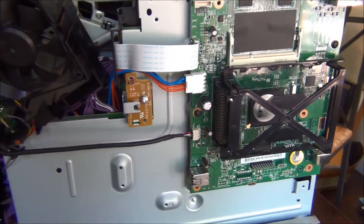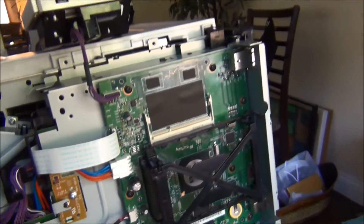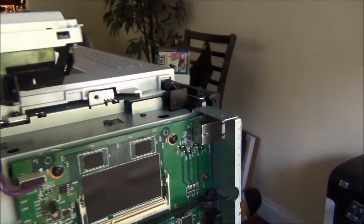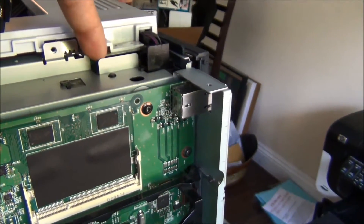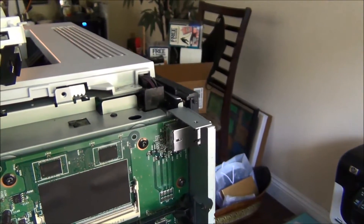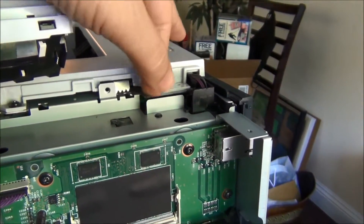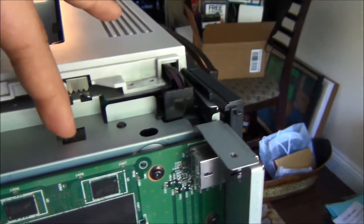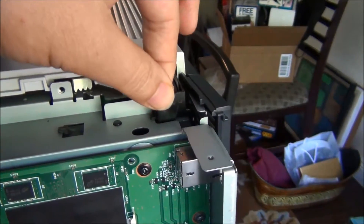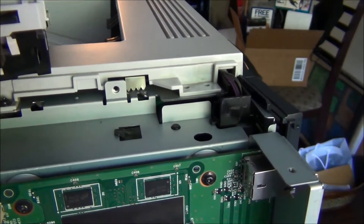So now I've got to figure out how to put it all together so I can close it, and then I'll try out the test and see if it actually worked. One more note — I had it all closed up and then I started it up and it started making this really bad noise of something scraping something. Basically I figured out that right here there's this little wheel that spins, and this plastic piece was not locked in correctly so it was hitting this wheel making a really loud noise. So I had to reopen it and fix this by attaching it where it snaps into these locations here that you can see.